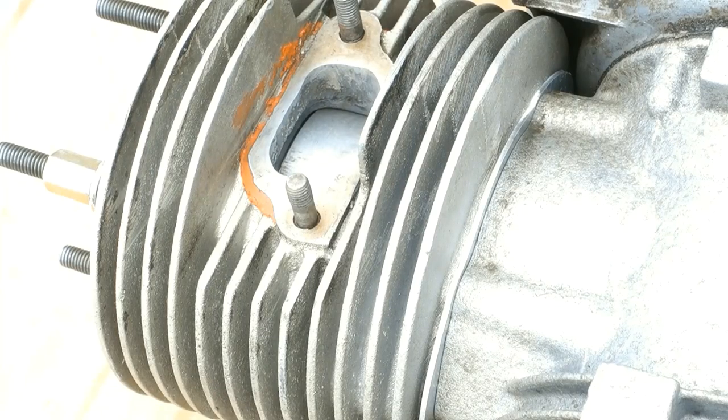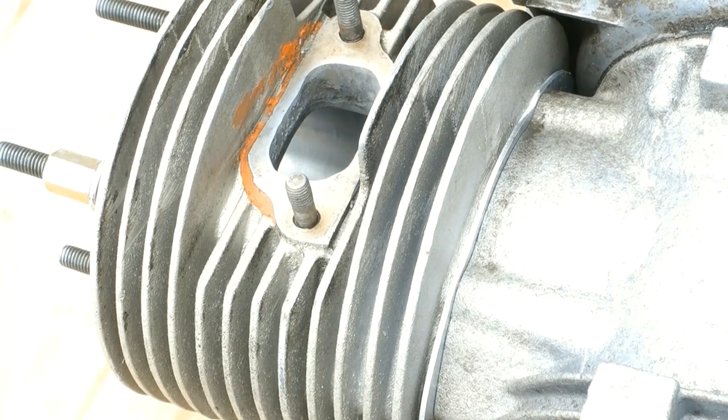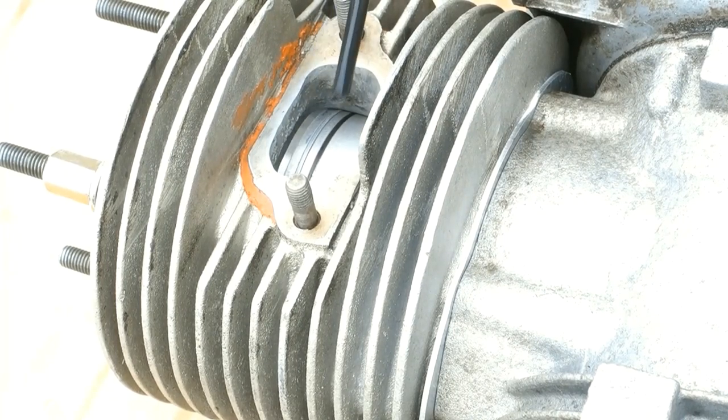With the engine in this state of undress, here is how I took the degree timings, starting from top dead centre on each occasion. The exhaust port opens from the top and on the downstroke. Look for the glimmer of light. Fully open, the combustion gases escape, and it closes on the upstroke. Again, look for the glimmer of light.